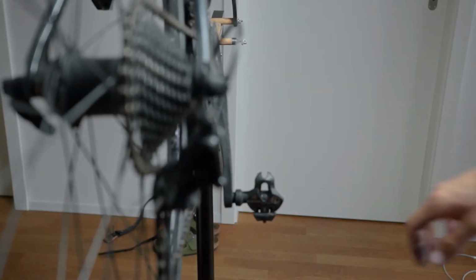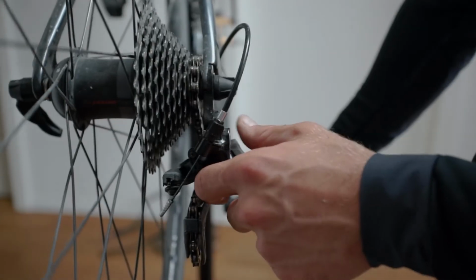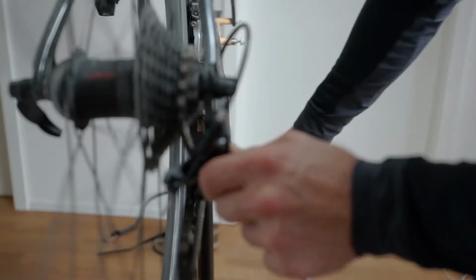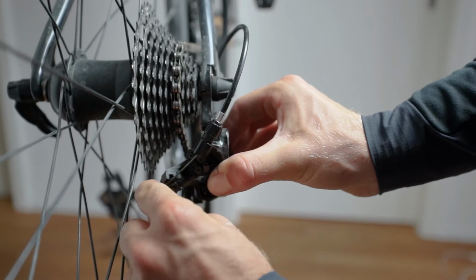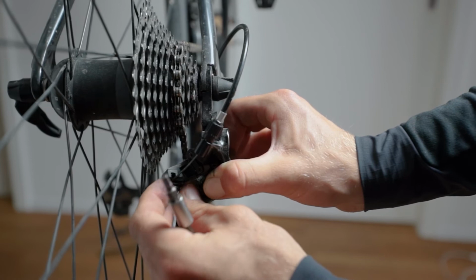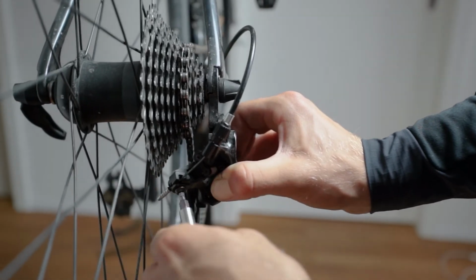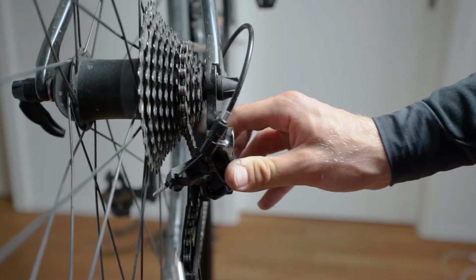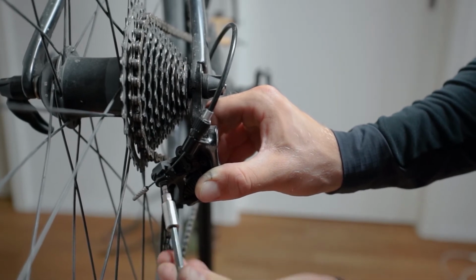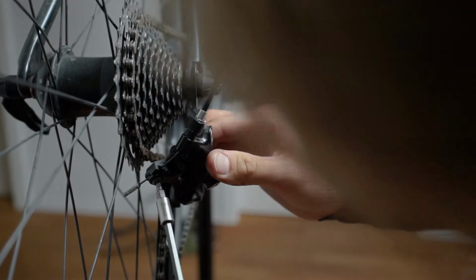So now it's time to adjust your cable tension. For this we have a rule of thumb, which is you shift up 3 gears, of course manually. 1, 2, 3. And from there you can pretty much just put the cable in without putting too much additional tension on it. So just leave it in the gear you are in right now and then tighten your bolt. Hand tight is enough for the moment. What's really important here is just that your cable is nicely placed and firmly tightened so it is in a secure place. We can worry about tension later.